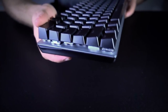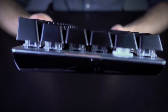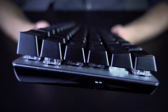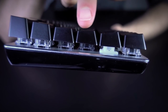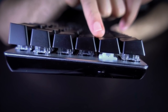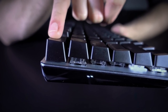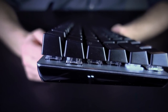Something else that I notice here, actually, while staring at this thing, is a very, very tall F row. Look at that. You look at the profiles, the heights of these keys. Or standard all the way along. This is, I guess, an R1, R2, R3, R3, R4 height profile there. And then this must be an R5, which you very, very rarely see.